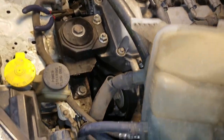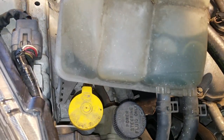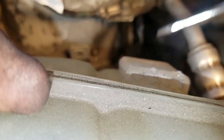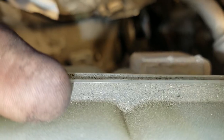We also took off the heat shield — you don't have to — and I took off the coolant reservoir; it's just two little tabs. This one pops off and then this one on this side has a little tab you have to kind of pry up. What I ended up doing is I grabbed a flathead and grabbed it from this actual plastic here, then pulled up on it and pulled up on the reservoir at the same time.